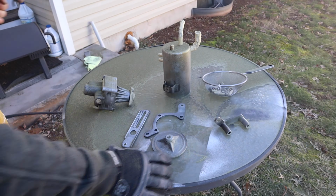Now that we know that everything's working properly, let's see what the steering weight is. While you're driving, the steering weight is great. You can feel that it's a lot smoother, but I'm a little curious on how the stationary weight would be. So if we turn this way, put our gauge on the steering wheel. Before we got around 15 pounds, so anything under 15 pounds, which is right here, would make me incredibly happy.